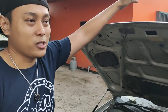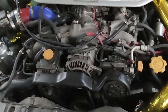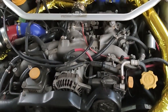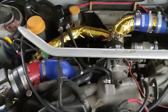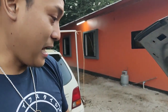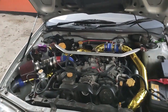Dude, I think it was my fuel pressure regulator. I tried everything, replaced everything except the fuel pressure regulator, because it's located right here, right in front of the turbo, under the inlet, against the fuel rail. And it's a pain to get to. You won't see it from here. You need small hands or elf hands to reach there without removing the fuel rail. It was a lot of work, but I had to do it to resolve my issue, and I think it's solved.